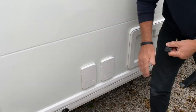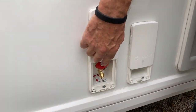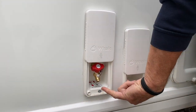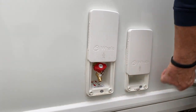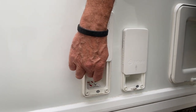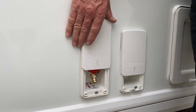The additional little caps all slide up. One is for the barbecue point — it has a chrome nozzle attached by a cable tie. That nozzle goes into the brass union and fixes in when pushed in, then you rotate the tap. If the nozzle is not in place, the tap will not turn and will not open the supply. Sliding that down, the next one is a 230V mains socket on the outside for external use.